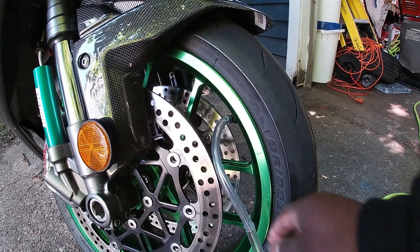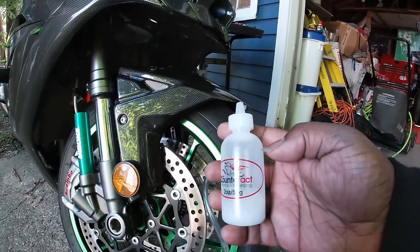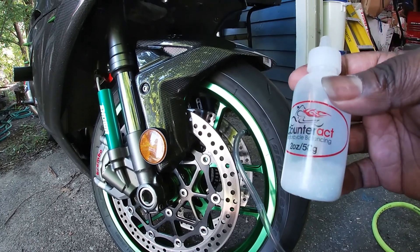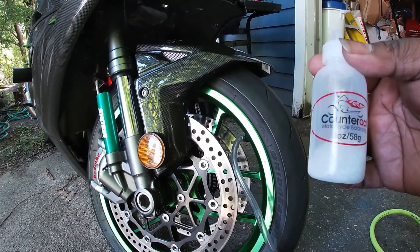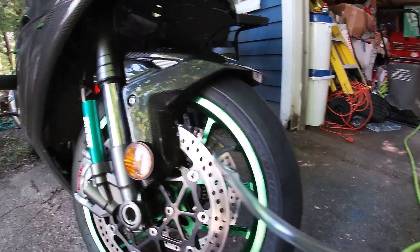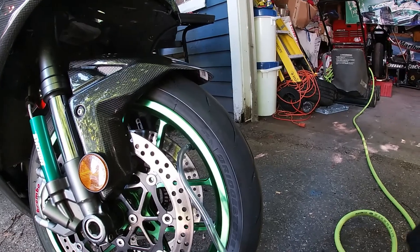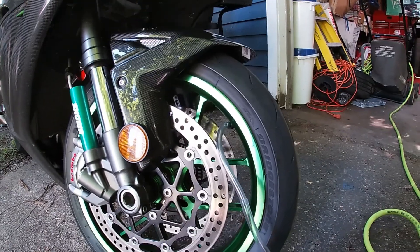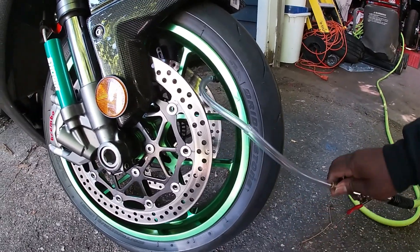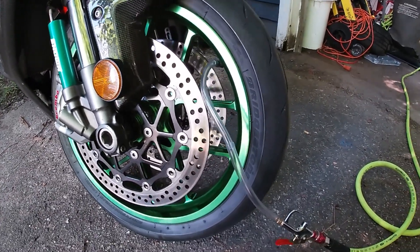I'm using the bigger tube just for more length. As you can see, the bottle has about two ounces in it, and I've got just about all of it loaded in. I'm also using compressed air — I have an air compressor hooked up, so I'm just blowing the beads in. It's not going to be exactly two ounces since I lost a few during the install. The tire is already mounted and has a wheel weight on it, but it still has a vibration.